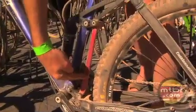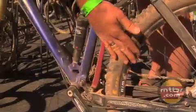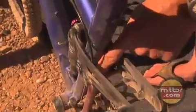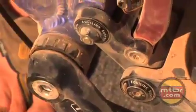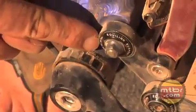Drivetrain forces come through the chain at a nearly perpendicular loading to the link, effectively isolating all the drivetrain loads from the suspension. New in the frame, we've got all sealed cartridge bearings in the front pivot and rear pivot, easy to maintain. The pivots inside the link itself are a roller needle bearing with external pivots and thrust washers that seal the system. Down on the lower end, same thing, exact same bearing technology. Through bolts, sealed cartridge bearings with dust seals and labyrinth seals on them.